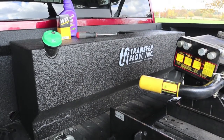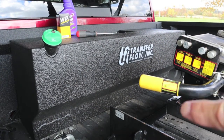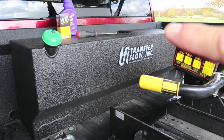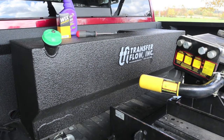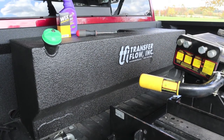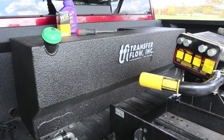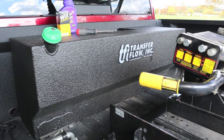All this fuel pump is doing is transferring fuel to the factory 31-gallon tank. As it leaves that tank it goes through an OEM fuel filter and water separator combination directly under the fuel tank, and from there it makes its way up to the engine. Right next to the back on the right side of the Cummins engine you have a two-stage fuel filter, and on the final stage of that filter it gets down to three microns. A human hair is about 50 microns in diameter, so a human hair could actually pass through this auxiliary fuel filter — it won't hurt a thing. The water separator will probably catch it, but if it makes it to the final stage, it's stopping everything three microns and bigger. That's a pretty impressive fuel filtering system. If you have any questions, please ask in the comment section. Thanks for watching and travel safe.